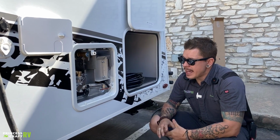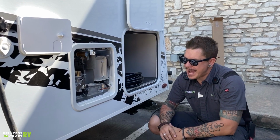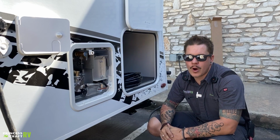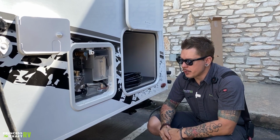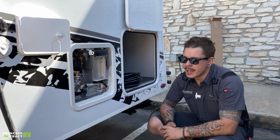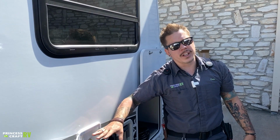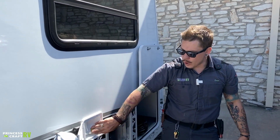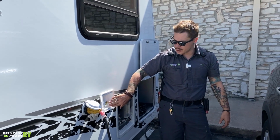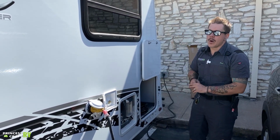On the flip side of that conversation, the manufacturer does also recommend that when you're returning the unit back to service, it is very important that you prime the unit or feed 6 gallons of water to the unit. To do so, you're going to again focus on the hot side of any fixture within the unit, and instead of cutting the flow of water overall to the unit, we're going to introduce that. So again, if we're on city water connection, we're going to physically turn that valve on at the fixture. If we're using potable water, we're going to physically turn on the 12-volt water pump.